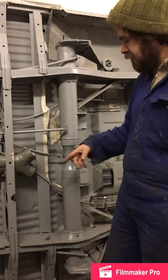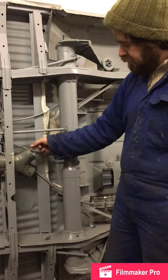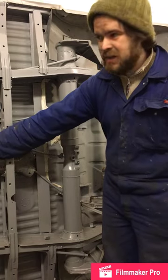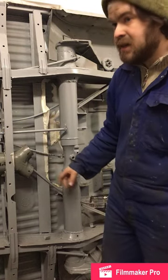The piece comes in one section but it's actually made of three bits spot welded together, so I drilled out — well, ground away the spot welds. So I've got three bits. This is the first bit I've managed to get in, and you had to slightly crush the end of it to get it through — only by about 2mm or so — in order to expand it again if needed, to get that piece in.